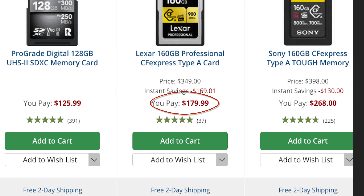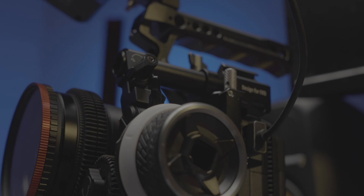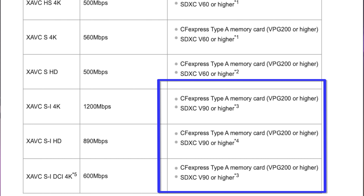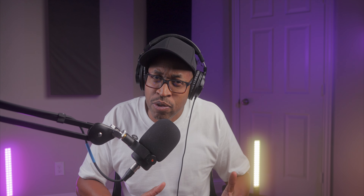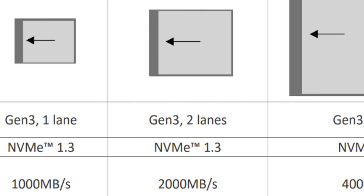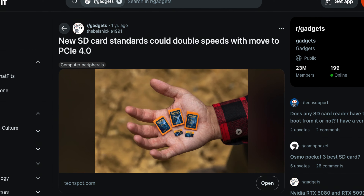All right, we're at the summary. Should you upgrade? The short answer is yes. If you can snatch one or two up on sale, the read and write speed improvements are well worth it — but paying full retail on a slower Type A card is a no bueno for me; if it's not on sale, I'm not buying it. Depending on the camera model, SD cards might not be fast enough to enable all high bandwidth file formats, and dropping in a CFexpress card may unlock some features, though V90 SD cards get me about 95% of the way there. The form factor of A versus B still concerns me — Type B cards do have two data lanes, so I get the speed difference, but I don't like that Type A cards are priced higher. CFexpress is the future, and with PCIe 4.0 coming out soon, both types will only get faster.